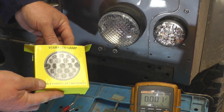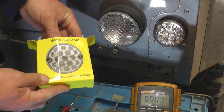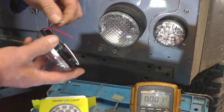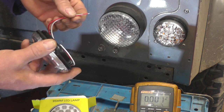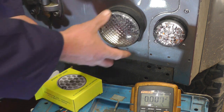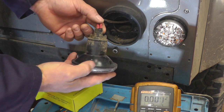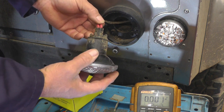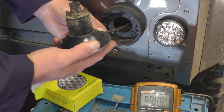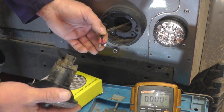While we're fitting this LED conversion kit we're also going to fit an LED reversing light and fog light. The fog light comes with no connector block to plug in, so we need to make some wiring adjustments on the inside of the old unit. Bringing the old unit out, we can see somebody's already put some connectors on there which have seen better days — they're not factory standard — so we need to identify which is positive and negative, then chop these off and reconnect the two cables together.